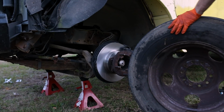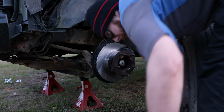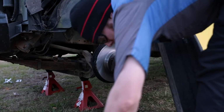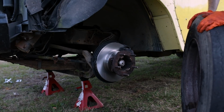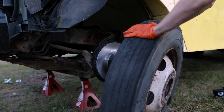When that brake hose comes, we're gonna have to bleed all the brakes, and actually off camera just now I bled this caliper because it was hanging up. I think it's because of the pressure stuck in the other hose. I hope that's all it is. I hope this caliper's not hanging too. But it's just as black as can be. Really, really bad condition brake fluid.